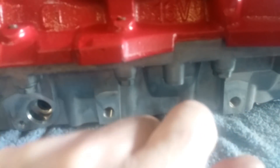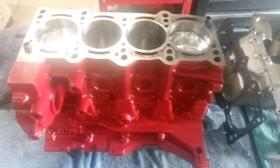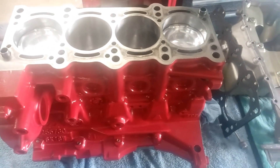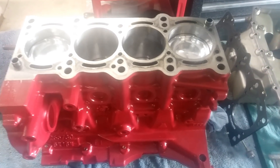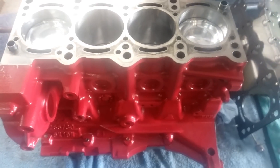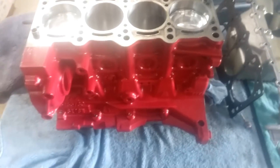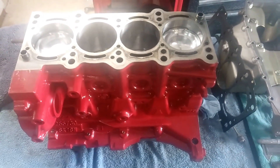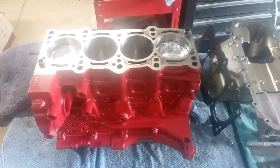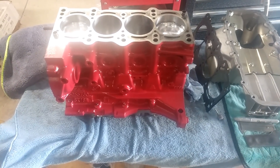Now in the last video we talked about this sealant. There's no gasket here, it's always sealant, and according to the manual you've got to use the official Fiat stuff — it's super expensive. I ordered two tubes of that stuff, 70-something dollars. It got here and it was hard as a rock; there was no way you could squeeze it out of the tube. In very small fine print on those tubes it said expired in 2015. The time of this video is 2020. So the stuff was expired. Was I going to order more and find out it's expired again, delaying things another two weeks? No.